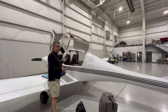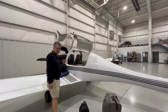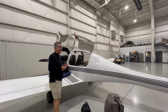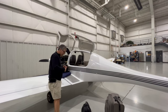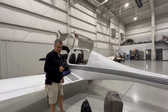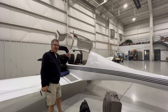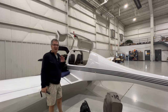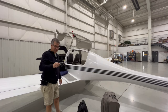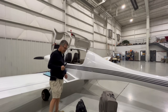This is something I don't talk about a lot because usually we're talking about training in the plane or flying the plane, but when you really start flying and using your pilot's license to take trips, this is a great thing. The useful load on this plane — it's not the best, it's about 780 pounds. There are planes with plenty more than that, but we managed to get all this stuff in here. I've weighed everything. I do have a luggage scale. This is kind of important when you start traveling — you don't want to ballpark this stuff. We have about 140 pounds worth of luggage, got a few 20-30 pounds worth of stuff I normally carry in the back. You've got Jim and I with 33 gallons of fuel. We're within two pounds of full gross weight. You don't want to be ballparking and end up overweight just because you didn't get the right measurement.